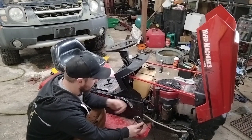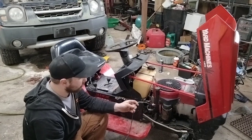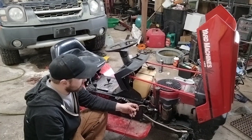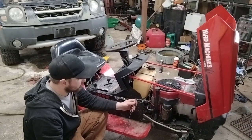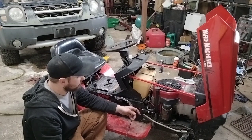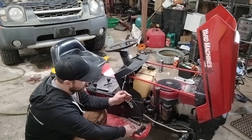And it's the perfect length of cable, and I like this little 90 degree elbow, or whatever you want to call it. Maybe it's not quite 90, but it's a good little elbow piece, and it angles it just right at the governor arm, which is what I usually do. There's a governor arm coming out of the side of the engine there. I'll show you here in a minute. And I just rig this around the arm with a little cable clamp. That way, once you've got the tractor running, and the tension's on the governor arm, you can just give this baby a little bop.